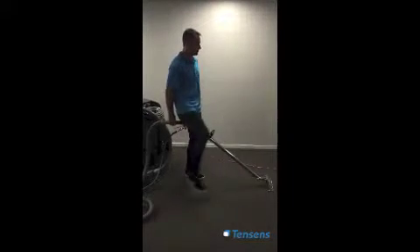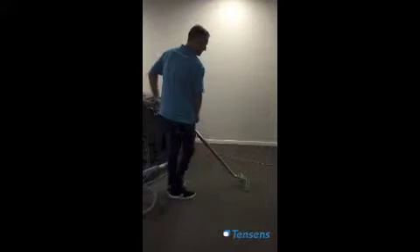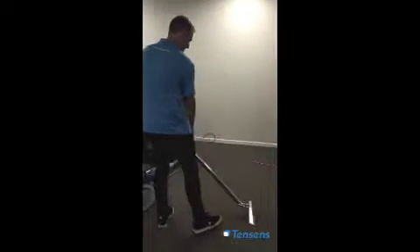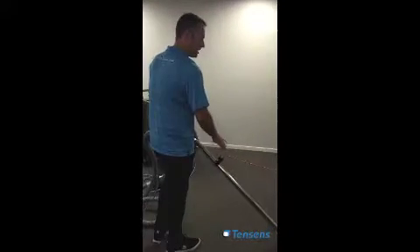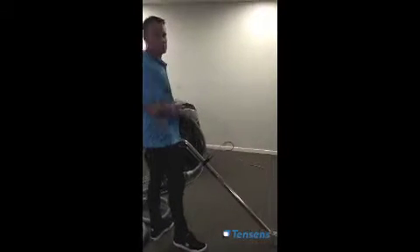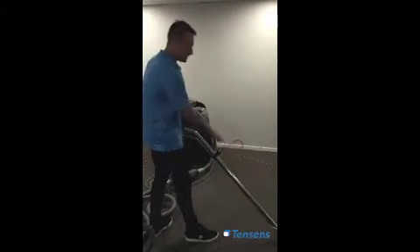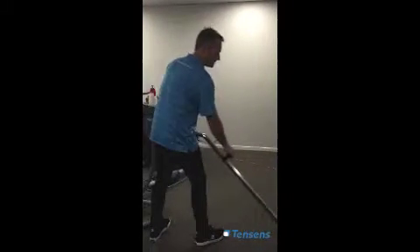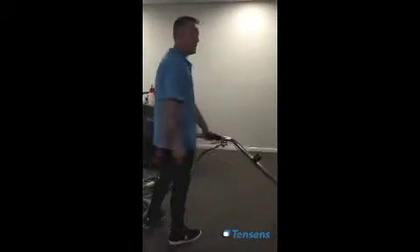You can do that left or right-handed. So if you get sore on one side or you're doing a really big job, you can switch. I'm not leaning on the wand to push it into the surface — this machine has got enough suction and airflow to do all the cleaning for you. If you've got a really nasty stain, hold the trigger down and give it a really good scrub until that stain goes. Then do an extra couple of drying passes over that area. Always do your drying passes after you've cleaned.